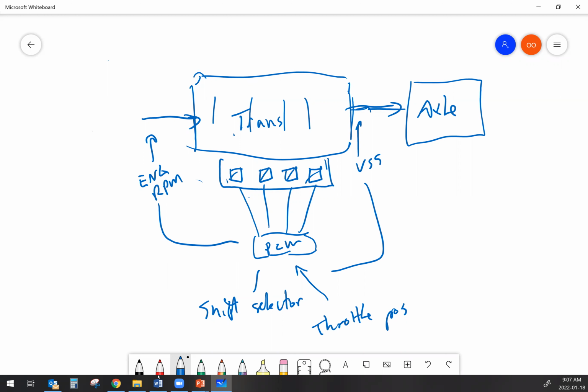Okay? Now, a lot of the auto shifts will give you a manual mode where you can select your own gear anyway, right? So nowadays, what I just described, you might call an automatic transmission if you've got a torque converter in front of it. You might call this type of transmission an auto shift. You might call this a power shift if you still make the operator manually select the gears and not just the direction. But you strip away whatever the control mode is and take a look at it, the transmission itself is the exact same thing, isn't it? Gears, clutches, brakes, controlled by a hydraulic valve, or valve body, I should say. And this is what we've got.